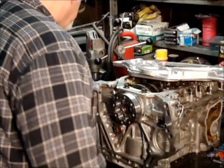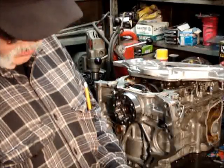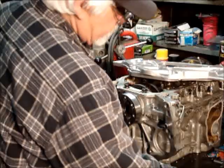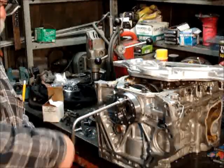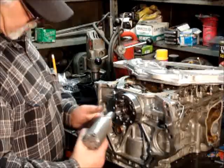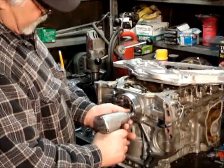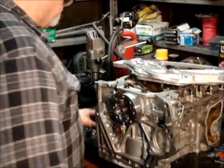And then I used the standard manual flywheel bolts that are 20 millimeter long. No longer, no shorter. There's 8 of them. Be careful on these couplers because it can be cocked. So you shouldn't use an impact on it on the first pass until you get everything nice. And I torque them. Do that in a very even manner to try and get that in there correctly.